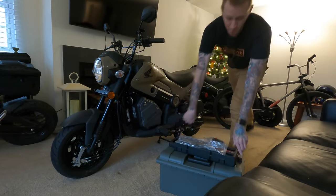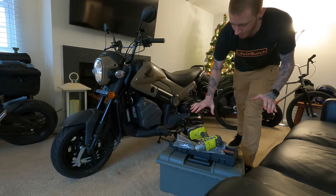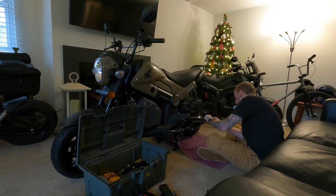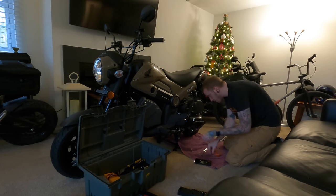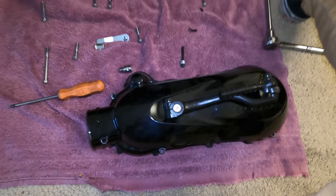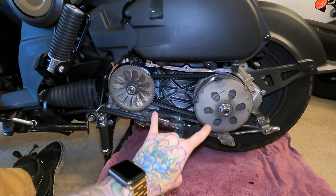Either way, we got our baseline done. We got the Navi in here to finally get some work started. So we got the transmission cover off right there — it was fairly simple, and you can see that's what it looks like with it off. You have your variator up front and the clutch out back. Both of those we're going to be replacing today.